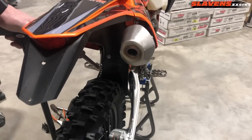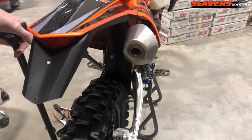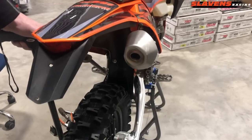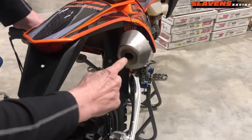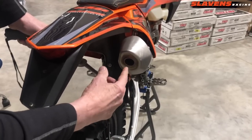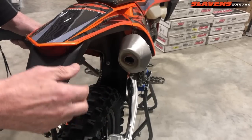In the process of this video, I'm going to try to help you guys sort out what you want to do to your bike, what products you want to buy, and debunk some of the snake oil products that are out there — there's plenty of them. Right here from the factory is a restrictor plate. It looks like a plate with a bunch of holes drilled in it, and that really restricts the flow of the exhaust system.